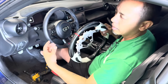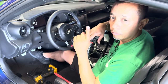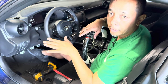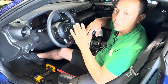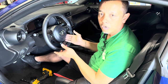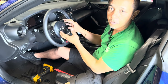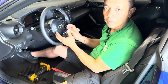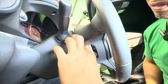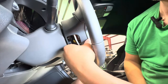It's kind of dark back here and if you haven't done it before you've got to be careful. Also, take note — take the battery off and leave it disconnected for about five minutes before you do this. What happens is you run the risk of deploying the airbag, which will hurt you — especially if you have it clipped out on you. This will put some serious hurting on you, so please be careful and cautious. We're getting ready to pop the clips off of this airbag.